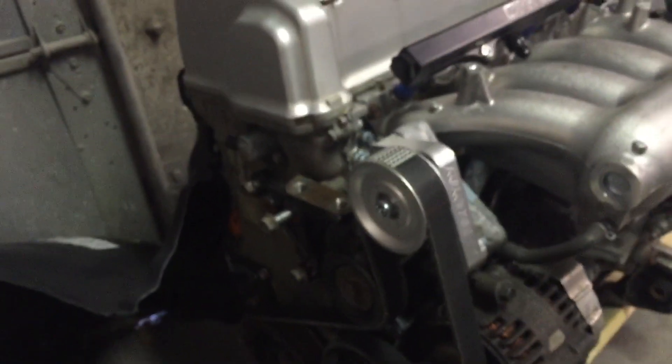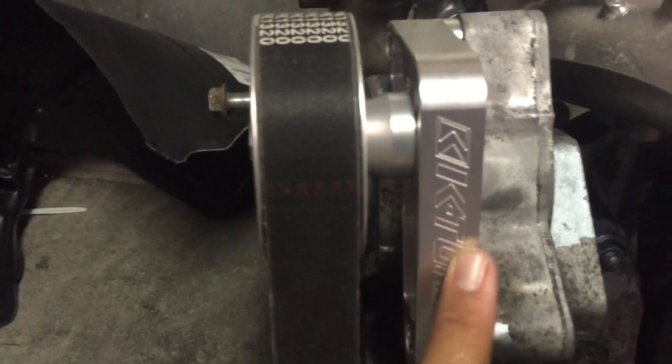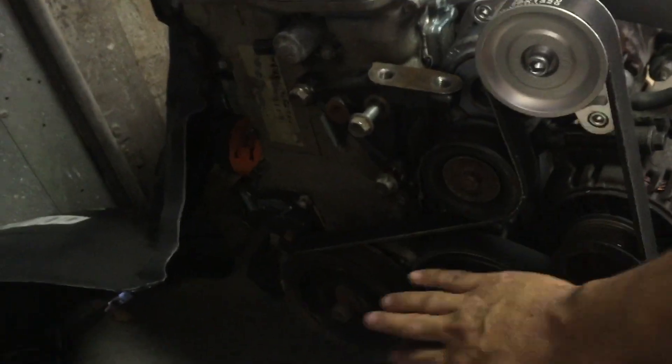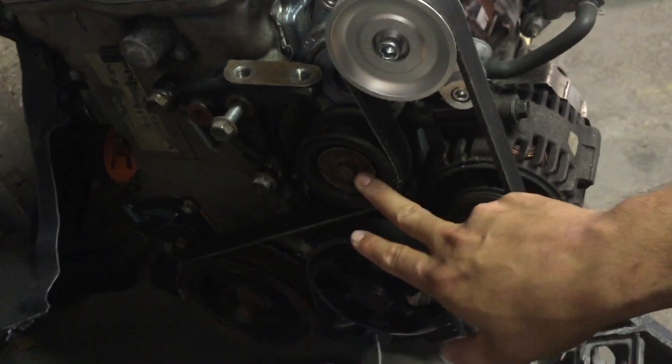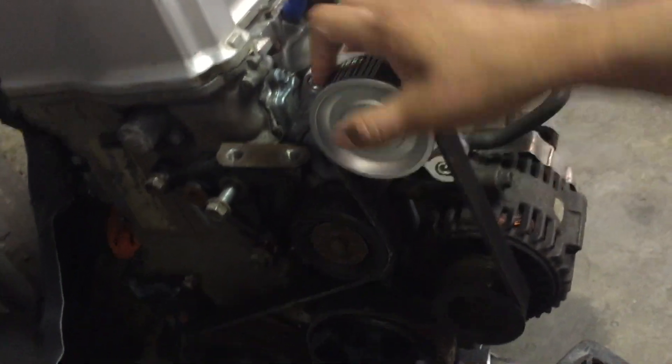There are different ways to do it, but I went ahead and got a K-Tuned EP3 pulley kit. I also got this belt to go with it — it came with the kit, part number is on it, also K-Tuned. This eliminates power steering and AC, so it's strictly the crank, water pump, tensioner, and alternator.